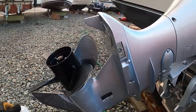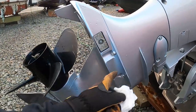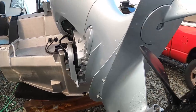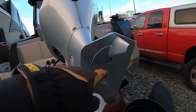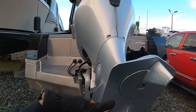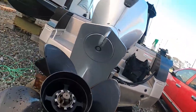I have the motor raised up, getting ready to pull this lower unit off. It should separate cleanly. There are six bolts that are easily accessible, three on each side. Then you have to remove the trim tab and pull it off, and then under it is another 19 millimeter bolt somewhere right around in here.